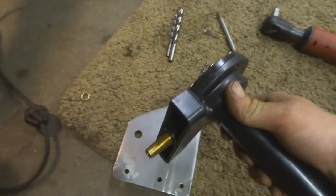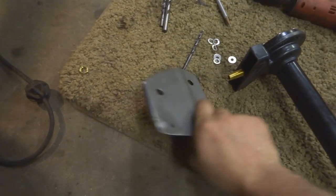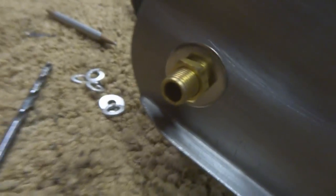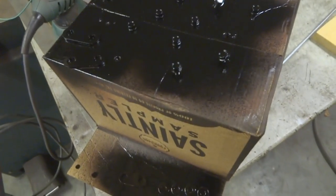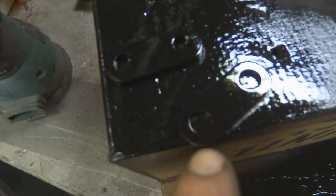The horn takes a 0.40 drill bit, but I used a 0.425 drill bit for a little clearance tolerance. It goes on there, then you take the washer and jam nut that come with it. The fitting doubles as the mounting point and the air inlet. I'm on a tight schedule — this is a one-day, basically 24-hour turnaround. I need to get the parts painted right away since the paint takes 24 hours to dry.